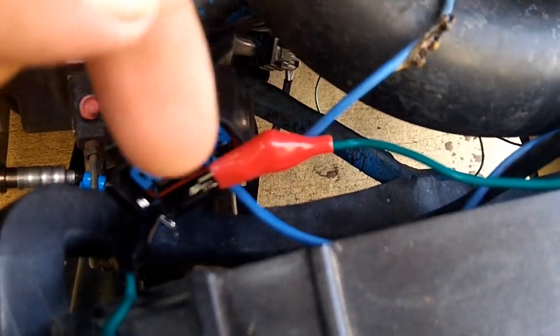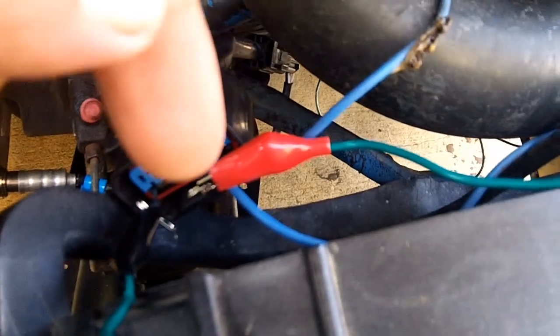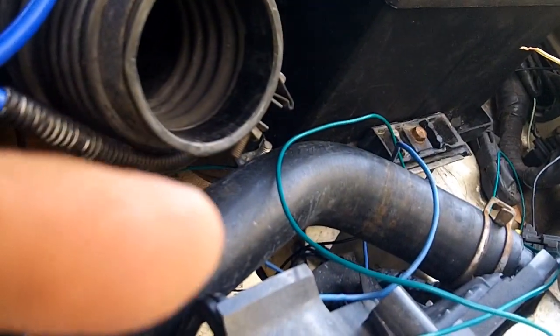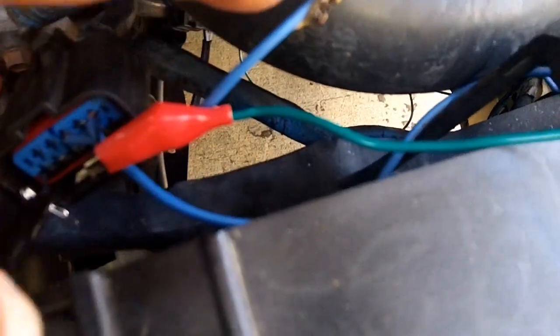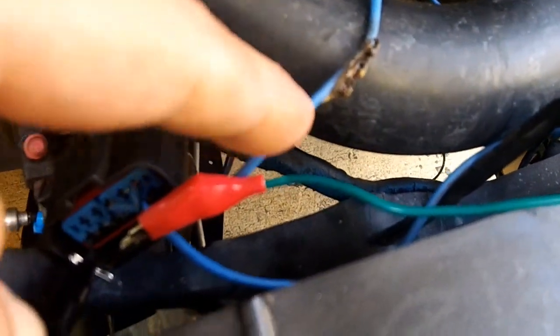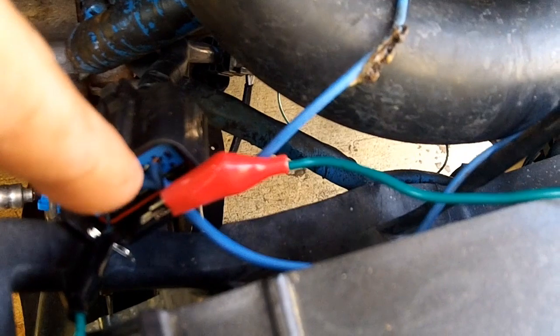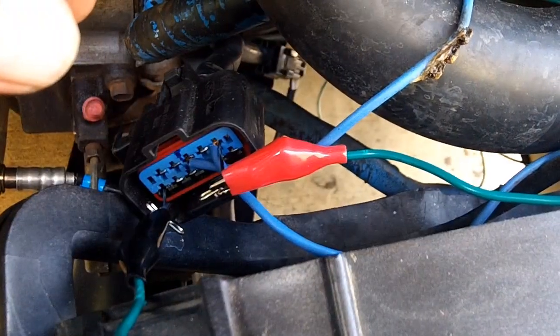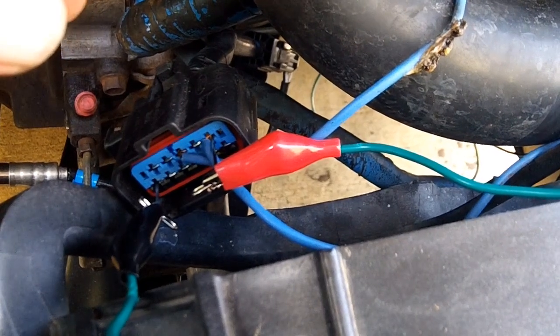It's like a check valve. It won't let it go past the diode, which is what we want, because we don't want it feeding back to the relay, because then that energizes this other blue line. It will also energize this one and turn on park at the same time, completely defeating the entire purpose of the relay. That's all a diode does. It's a check valve, basically.